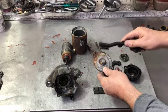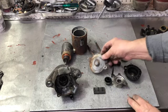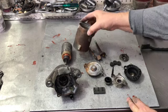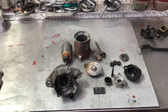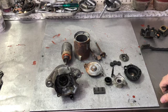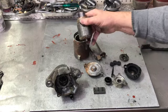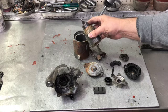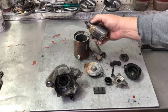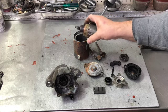This is what the wire brush is for — we have to go through and get all of the rust off as much as we can, especially on the outer housing. If you have a wire wheel mounted on a grinder or a wire wheel that goes into a drill, this would be a great time to use it. We're going to take 80 grit sandpaper or some Scotch-Brite and clean all the arc off the commutator so that you've got a nice, clean, shiny surface.